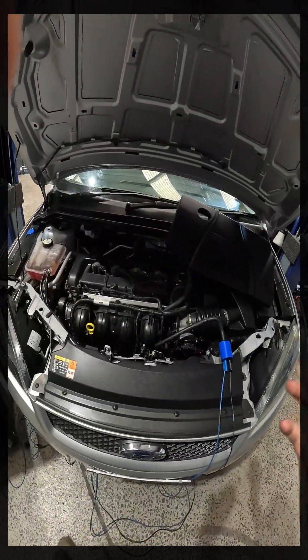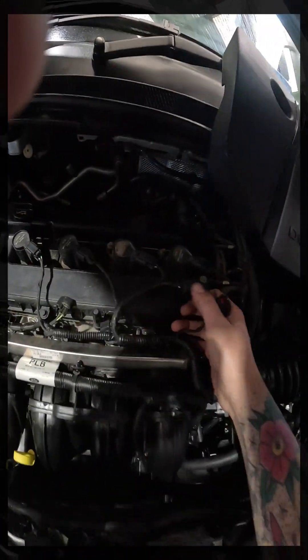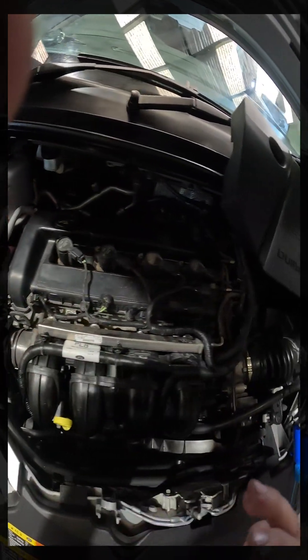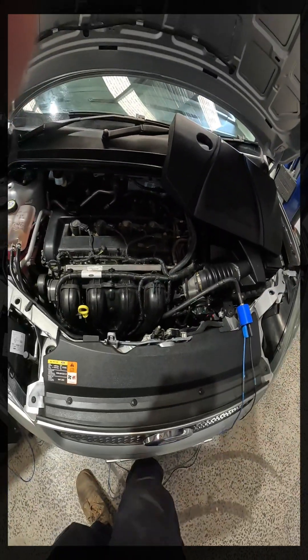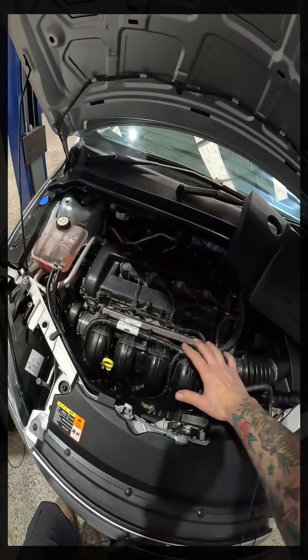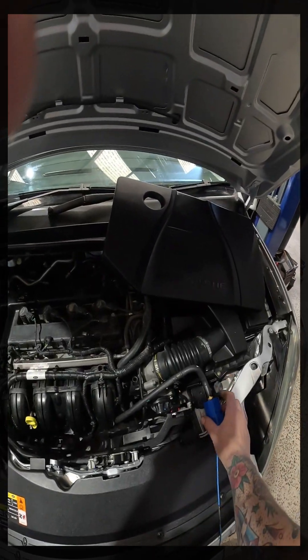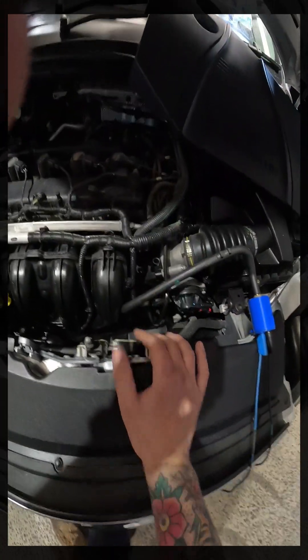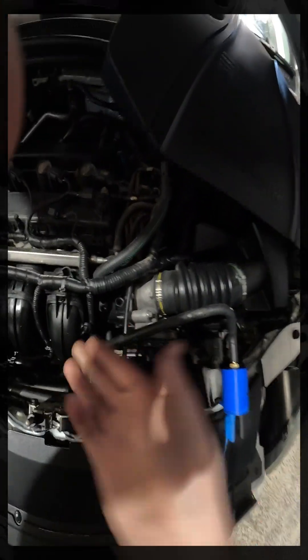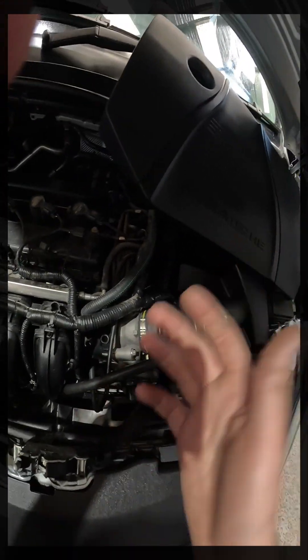What we're looking for here is an even pattern. At the minute I've got our injectors unplugged. Going back to our example — we've done a relative compression test, we're worried about an in-cylinder issue or a valve train issue — I will put a pressure pulse sensor in the intake manifold. Right here, all we're plugged into is a vacuum line, but you can just put it down into the air box, ideally behind the throttle body, but wherever you can get it.